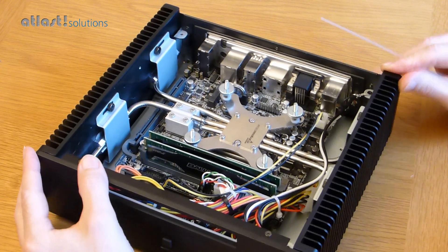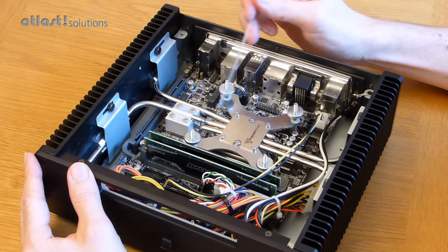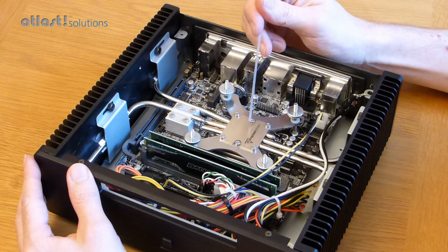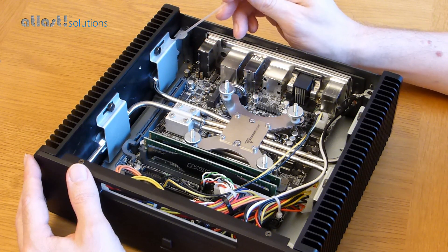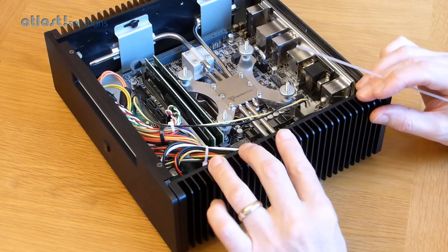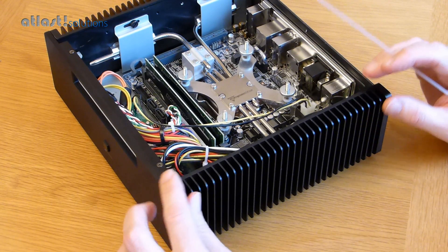Here in the middle of the motherboard is the main processor, and you can see these three pipes — they are called heat pipes. They transfer heat from the hottest part to the coolest part, so the heat transfers from the CPU down the pipe to the edges of the case. The edges of the case are made of solid aluminium radiator grills, so they are basically great big heat sinks that dissipate the heat into the room.